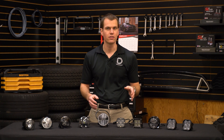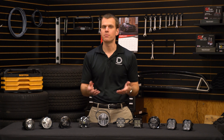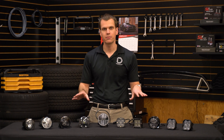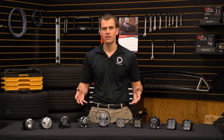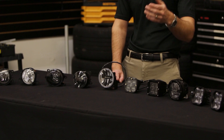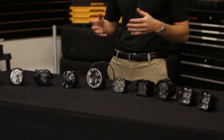When we say LED fog light, we're referring specifically to the J583 SAE standard for fog light performance, and a big part of that is the beam pattern which requires a sharp cutoff line and really wide distribution to light up the ground right in front of the vehicle. All ten of the lights we have here today meet that standard, so we'll be showing you the measurements and test results. If you're here just for the results, go ahead and skip to the end — we've got all the info there.